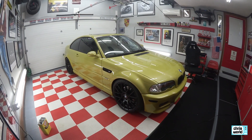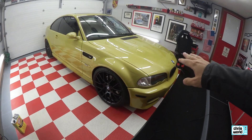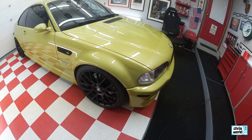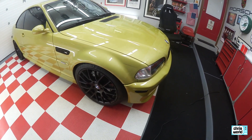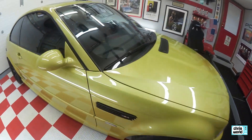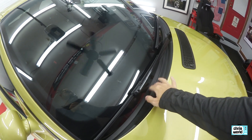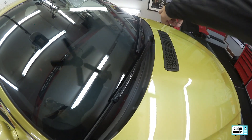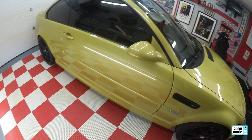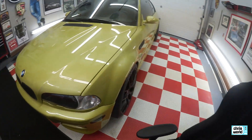That's kind of where we are right now — prep mode. I got five days. The biggest challenge is just getting that crap off. Once I do that, the polishing, buffing, and waxing the car should go pretty smooth because really the rest of the paint is perfect. The interior is pretty good. One thing I will have to do is treat the rubber seal here on the windshield — I did this side, so you can see it's a little bit darker than that side. I need to treat that side to match it.